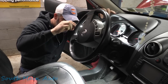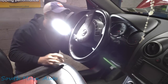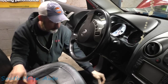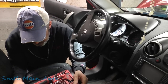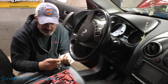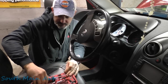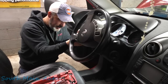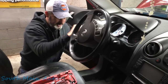We have a new one here from Nissan. To do the job, we have to pull the airbag out first. There are a couple of plastic tabs on the side of the wheel, but it looks like tamper-proof Torx bits — T30 tamper-proof, which has a hole drilled through the middle. With one of those you can take out a Nissan airbag.